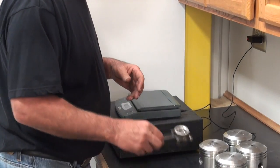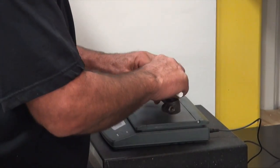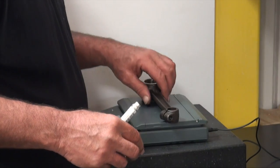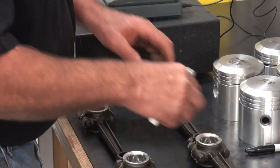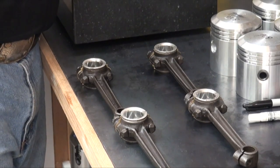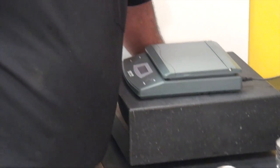Rods — there's a lot of schools of thought here, but these rods should all be within a few grams of each other. 612, 610, 612, 610 — so I've got two that lay out at 610 and two that lay out at 612. A lot of people just go ahead and install this and get on down the road with life, or never even look at it. You can balance the rods and you can balance the pistons and make everything work out to be the same weight.